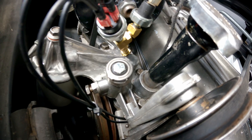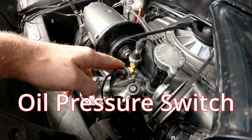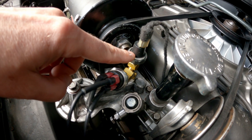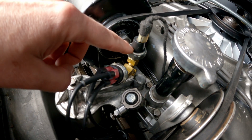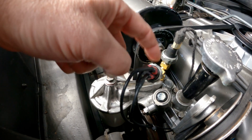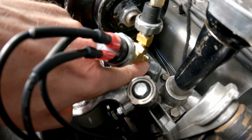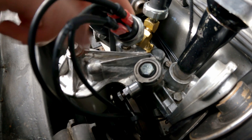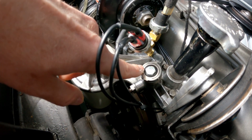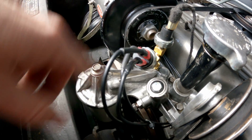The next piece of the puzzle is the oil pressure safety switch. The Corvair comes with a single-pole switch for the dummy light so it illuminates on the dashboard if you run low on oil pressure — you still need that, and it plugs in down below into the engine case. In addition, you'll need a three-pole oil pressure switch that tells the electric pump to turn on and off. I built a little Y out of basic NPT fittings so I could house both switches in the same location.